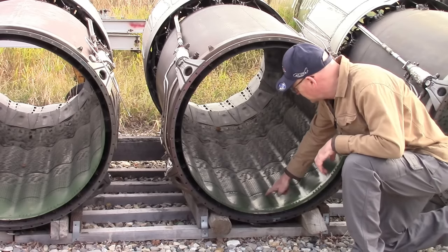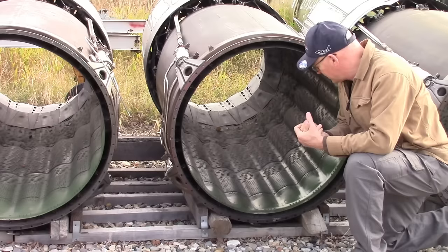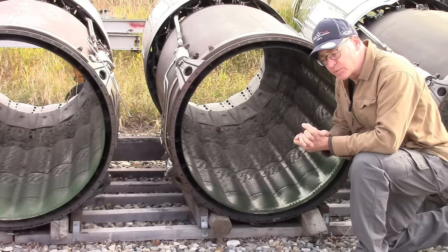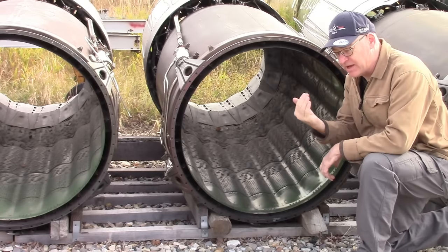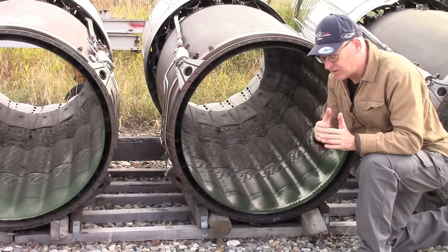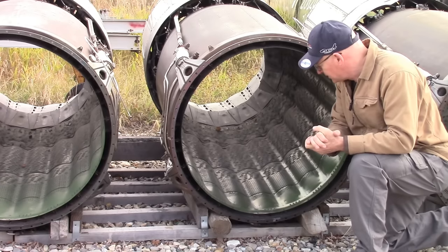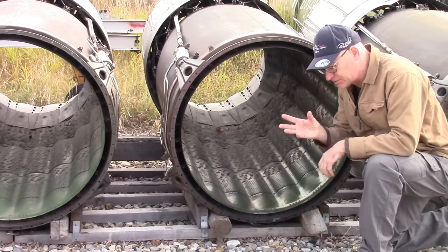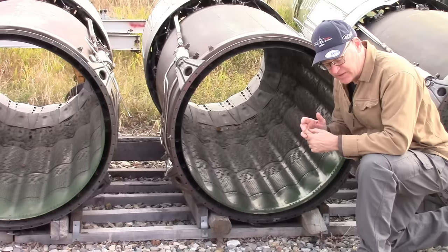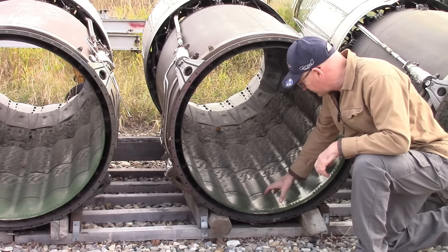These are the big bumps — these ridges here. What are they for? There are two things I can think of. One is that it's a way of increasing surface area. Sport racing motorcycles in the 80s and 90s started using curved radiators instead of flat ones, because for the same width of the bike there's more surface area on a curve than a flat plane. That may be part of it. But it might also be that if it were a completely cylindrical sheet metal tube, it might wobble and waver with the high velocities of gases flying through it, and it might also buckle.